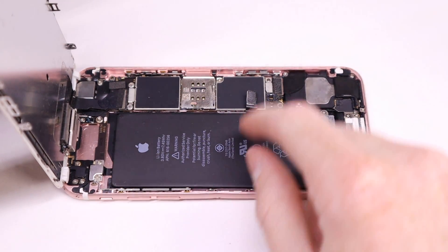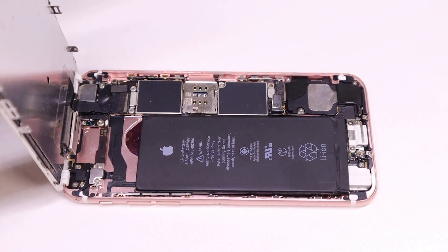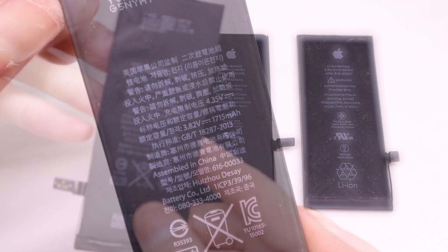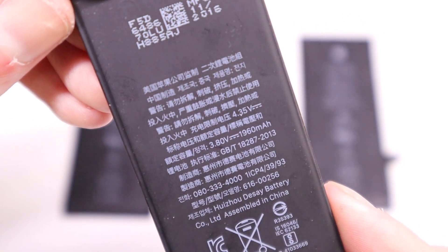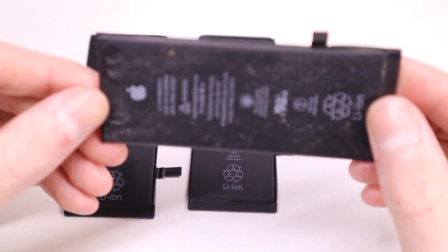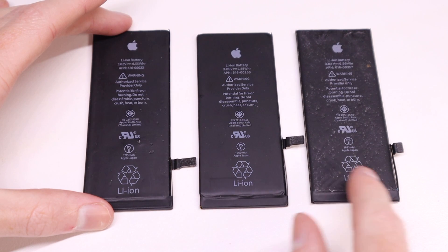So not only is the connector cable slightly longer, it isn't able to reliably power an iPhone 6s. On the other hand, if you had to quickly test out a 6s you could theoretically use an iPhone 7 battery or any other battery with the same connector as the iPhone 6s. Taking a look at an iPhone 6s battery, it has 1,715mAh. Compare that to an iPhone 7 which has 1,960mAh, and the iPhone 8 battery which has 1,821mAh — less than the iPhone 7 battery. Whether that was a marketing technique to push people toward the more expensive iPhone X, I don't know, but in terms of dimensions they're almost identical, with just the iPhone 8 having a different connector.